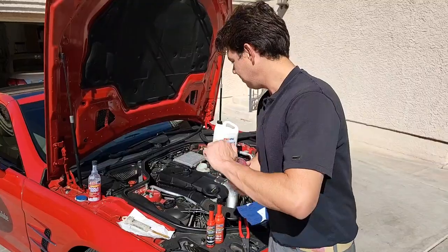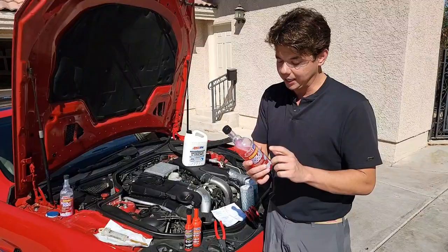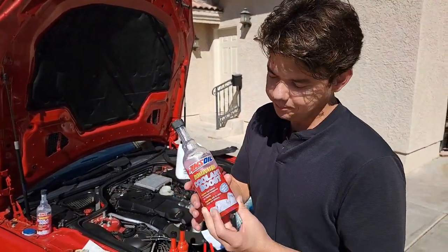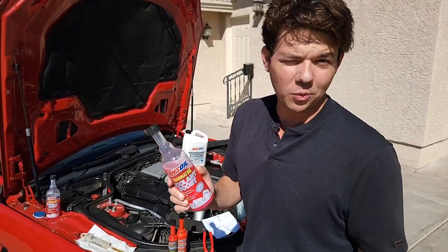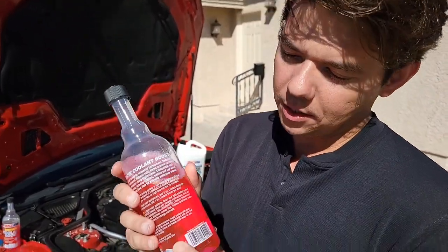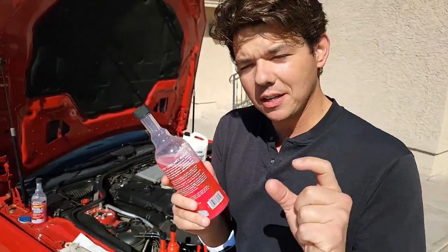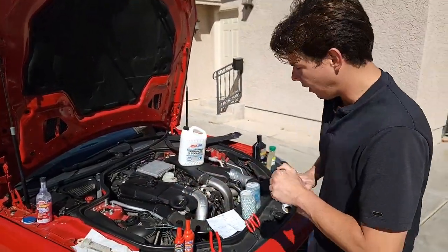The biggest power difference on this car was when I changed the intercooler fluid, which we're going to show you in a second. This is a 13.6-quart coolant system. We're running about 66% distilled water and 33% concentrate. We're going to be adding our additive — this is good for one year or 30,000 miles, whichever comes first. The surfactant breaks down over time, so we replenish the system.